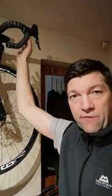So the first thing that I did was I stripped the handlebar tape on the side of the lever that I was changing the cable on, stripped that right back to the middle of the bars, and then got the levers forward so I could get to the internals of the lever itself. I then went to undo the pinch bolt on the front mech because you're going to need to loosen that cable off, and I'll show you why in a minute.